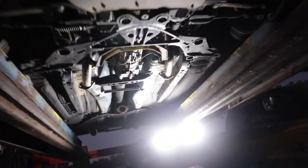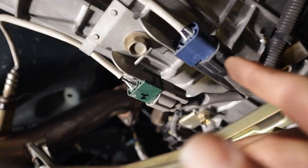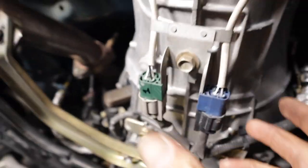It is starting to get chilly — look at that sky, it looks freaking amazing. Make sure you appreciate the world. Got the Y-pipe off. Next thing I'm going to take off is the driveshaft — looks like 17-millimeter bolts and nuts, and we should be able to slide that out. What I did to make it easier is I labeled the plugs — two and two on one side, and one and one on the other — so I know which plug goes back with which.